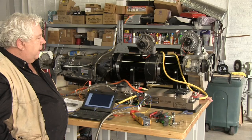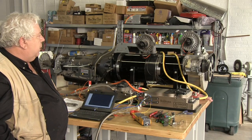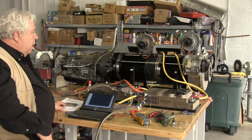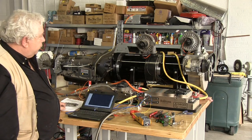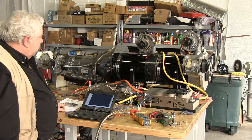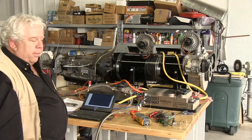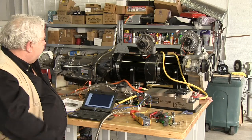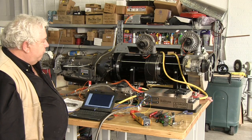So these aren't high HV motors. They're the normal NetGain 11-inch. They've been beefed up a little bit by Jim Husted and painted nicely, and the Hellwig brushes installed, and some little adapters we've done to put the blowers on them, but they're going to be black and silver, and I think they'll look great in that engine compartment. They're almost perfectly the right length and should mate to that transmission well.